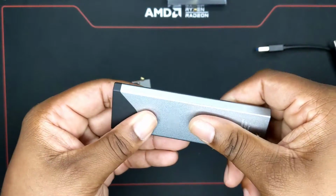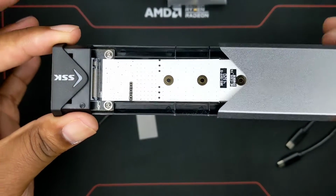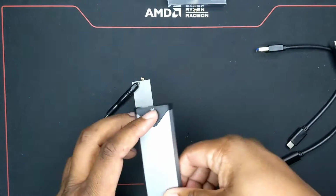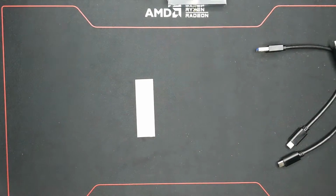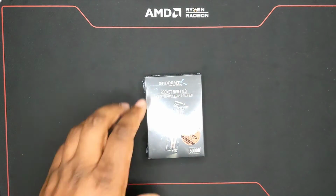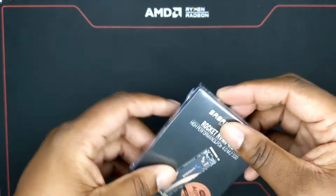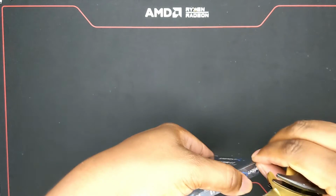I actually purchased a small desk fan, because I got this for my PS5 to extend the storage a little bit, and I got a small fan to have off to the side, because again, it does get a little warm. As you can see inside there, it's very simple packaging, very straight to the point, and it definitely gets the job done. This particular one is a PCIe NVMe M key, and it only fits 2242, 2260, and 2280. So again, we're gonna unbox this Sabrent NVMe 4.0 500 gigabyte drive, and I'll leave the links in the description for all these products.